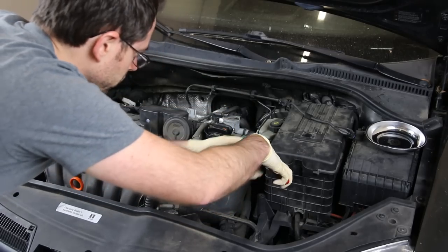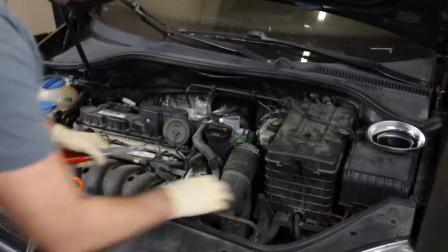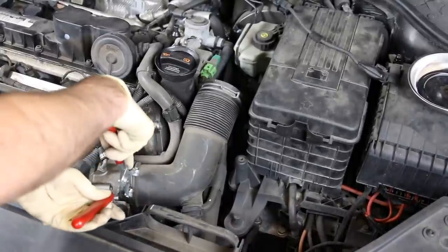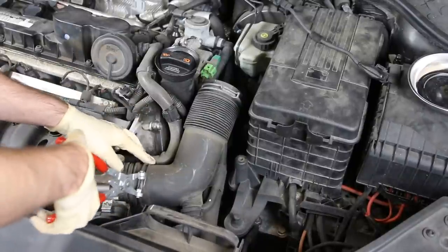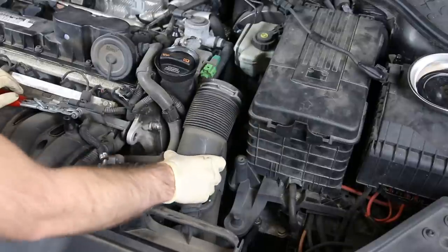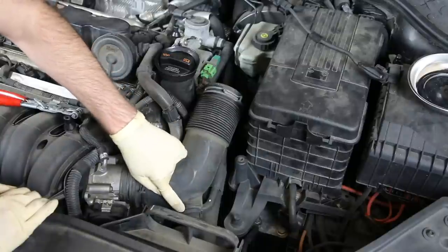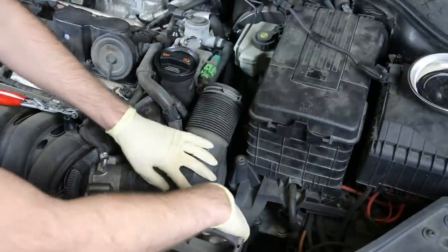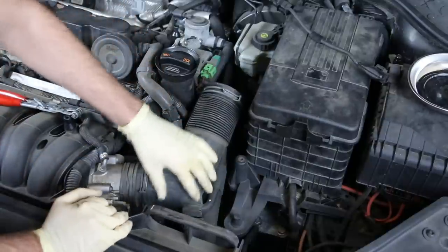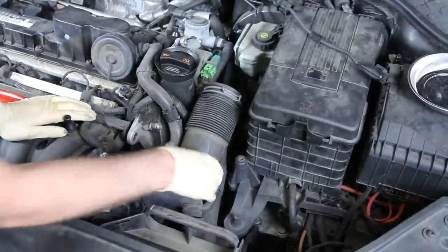What we're going to be looking for is to go straight down here, right below this hose. This pipe is the throttle body pipe, and we're going to remove it to get access to the area below it. Using the same spring clamp pliers — I'm going to let this one loose here. I didn't let it loose on the accordion piece because that's much weaker and it'll crush. You can just pull it back like that. These pipes here are for secondary air injection. You have a ribbed section right here — you push on either side of that, and the parts that snap on are right here, so you squeeze it and wiggle and it will pull past there. You can also use a flat head screwdriver on the side to get those clips past.